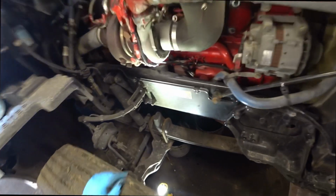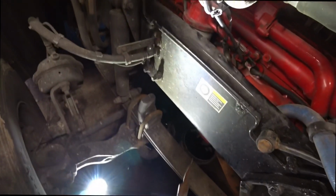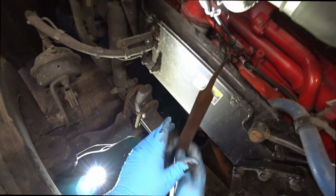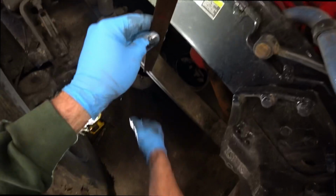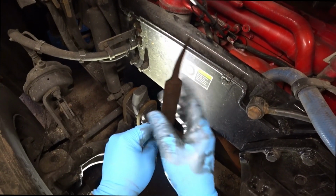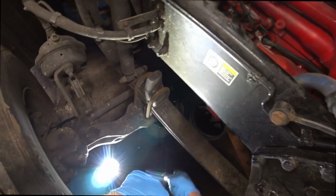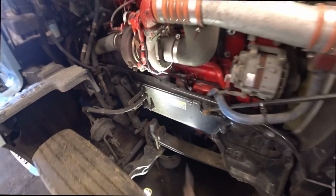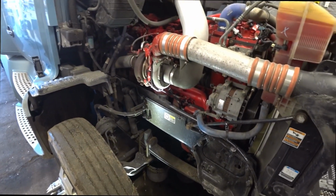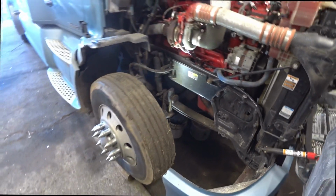Another little fact for you guys. When you do oil filters, you can pull the oil filter off. You can use just a file. It's got the point on there. Put it up underneath the oil filter, hammer on it a couple times. You drive this up into the bottom of the oil filter. Wiggle it, put a bucket underneath there, pull it out. Oil all drains out and goes into the bucket. That way when you pull the oil filter off, it's not all full of oil and doesn't just run all over the place. It's a little tip for you.